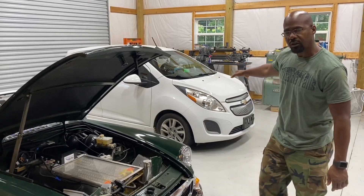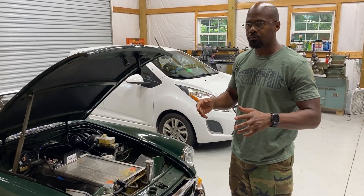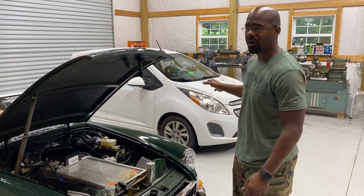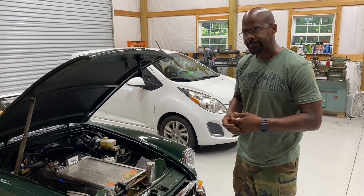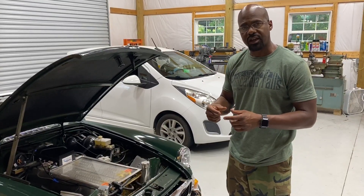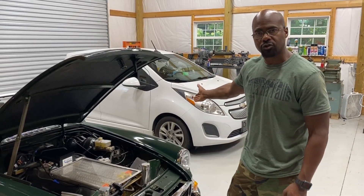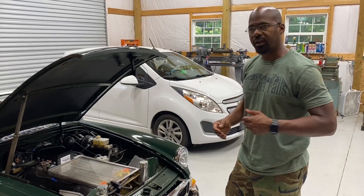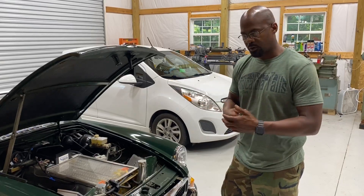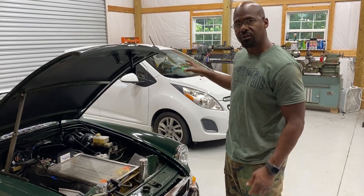This has got what you call A123 batteries in it — very powerful batteries. They're not really known for their energy density as they are for power density; they've got a lot of power to them. I plan on taking the bus bars that go between the batteries and increasing the size so I can get a little better flow. I'm going to put an open source controller for the motor so I can ramp up the torque — instead of a ramp up, it'll be more of an instant punch. So I'm going to make the system that is in this a performance system.